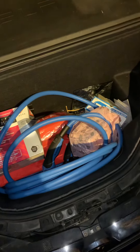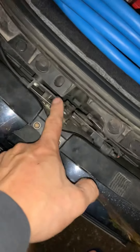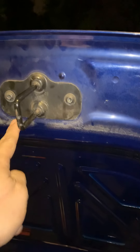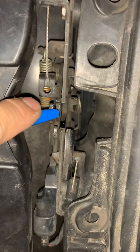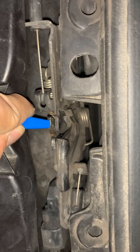Let me try to explain what the problem is and how you can check if your car has the problem. Let me pop open the front first. I don't have an electric frunk with me right now, so this is the OEM system. I already removed this little cover so we can see the latch here. When you open the hood, this is what we call a striker. When the hood goes down, you will do the latching. The striker will go all the way down and land here. When you continue to push down the hood, you will do the primary latching.